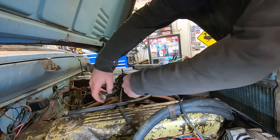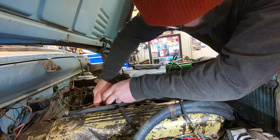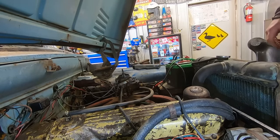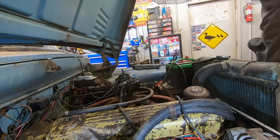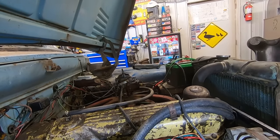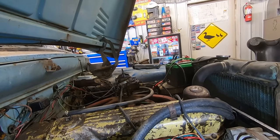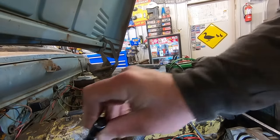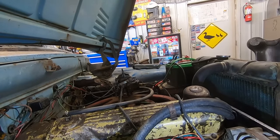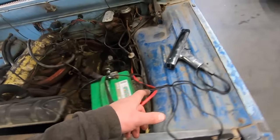So before we fire it up and set timing and try to find that oil leak, I'm gonna turn this idle screw down. That should help on all accounts. Let's see if it runs. Idle's good. Where's the oil coming from, though? Well, let's go check the timing. Got her hooked on the number one plug wire. Hook up the battery cable.